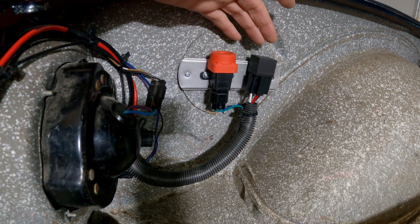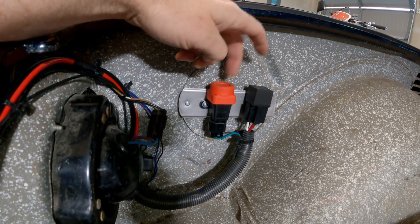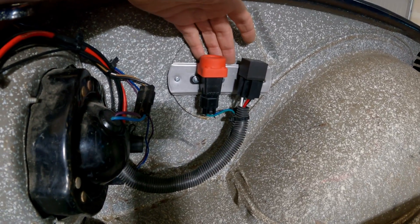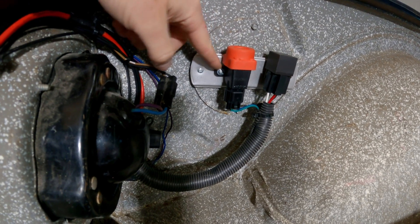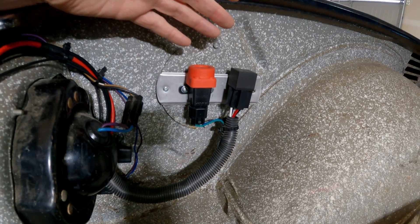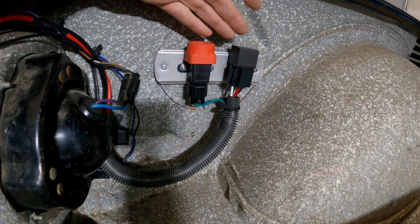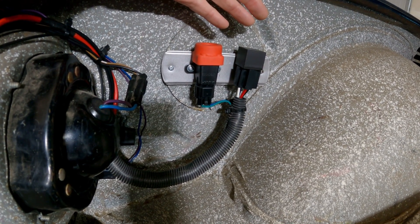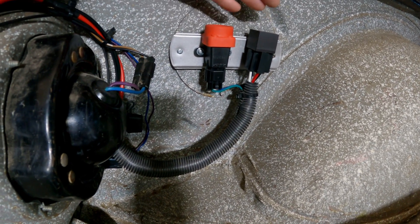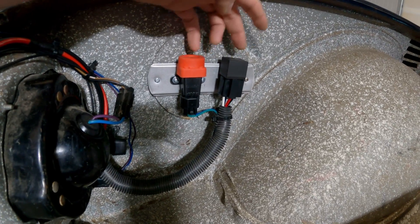The relay turns on and off based on input from the oil pressure sensor in the back and the crash sensor in the front. Once both criteria are met and you turn the key on, the pump turns on. If you lose oil pressure or experience an impact, the fuel pump loses power automatically. I didn't drill any holes — just made a small tin bracket from scrap and rubber-mounted it to the body. This being my wife's car, I want her to drive it with full confidence. She doesn't have to think about the fuel pump; it's all automatic, safe, and reliable.